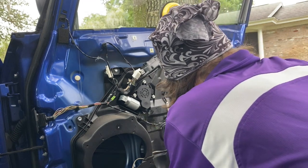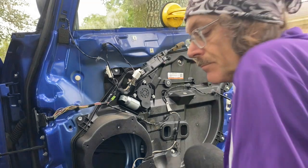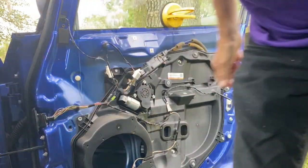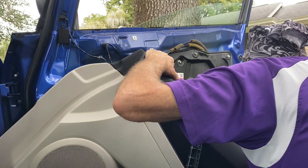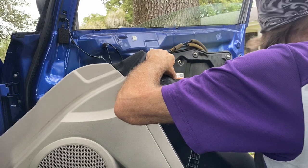And here's where I'm pulling off those caps to throw some lube back there. But you will have to bring the glass down about halfway. That's where the bracket will line up with those two openings. Those openings are also to get to the bolts that hold the glass to the bracket. Oh, that's where I masterfully edited out my error. So there you go. Never happened.